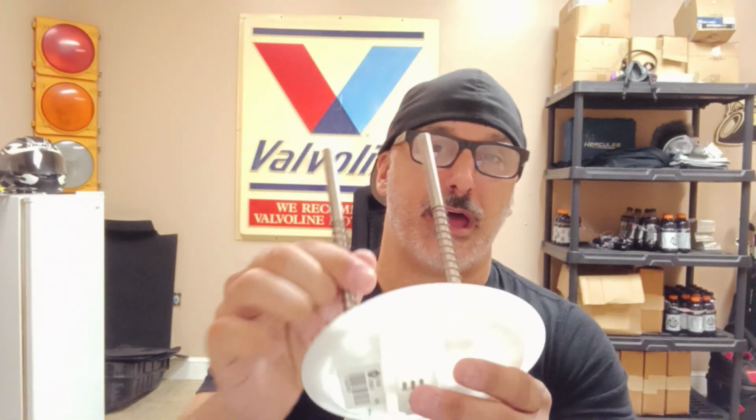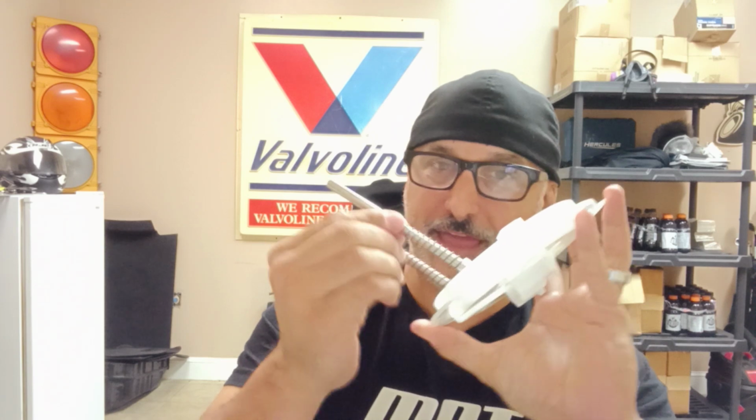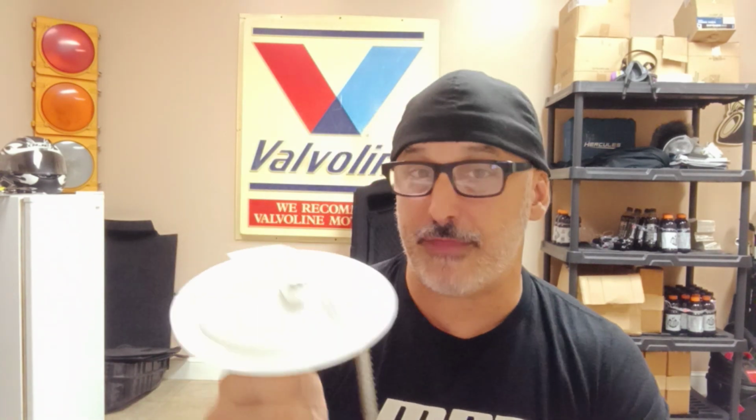When that ring pops off, the springs on the bottom of this hat let go, and these things have got the tension. If you have ever worked on a small caliber pistol, the slide spring in a .380 or maybe an early low pressure 9mm, it's not that far removed from this. When this thing pops up, the whole thing just goes pop and comes flying up. So just know coming into this, it's going to pop up and surprise you a little bit if you're not paying attention, or at least know that that's going on.